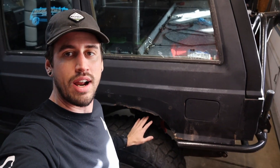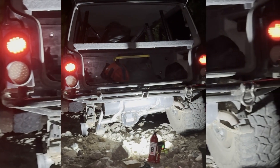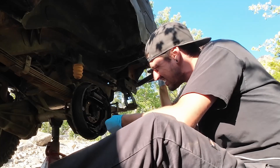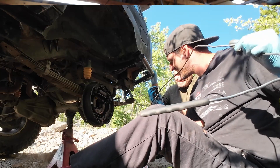If you watched the last Machines Inc episode, you know I have a little bit of work to do on this XJ. Today we're finally going to address the carnage that happened in the rear axle. Long story short, I snapped the driver side axle shaft, then continued to drive it for another seven to ten miles out of the trail. With the axle shaft broken and not located properly, the shaft was just scraping around inside the axle tubes. I cleaned out a lot of metal shrapnel on the trail, but there's so much left. Once it's clean, we can inspect for shrapnel in the differential carrier bearings and other areas. Fingers crossed we just need new axle shafts.